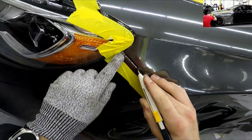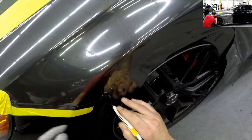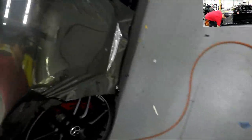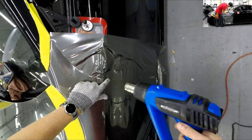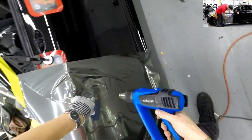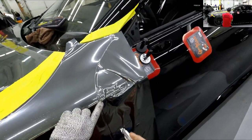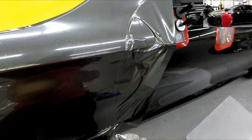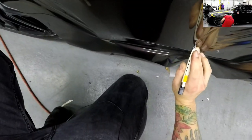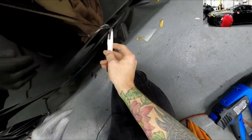I'm staying on the bottom edge for this cut. The vinyl can be polished — we tested it — so any swirl marks or scratches that won't heat out afterwards, we're going to polish. I'll go over this section with a bit of heat to make it smoother for cutting. It'll only get so smooth, and I'd rather not damage the vinyl. All the haziness you see right now from the shield guard is going to go away when I wipe it off. I haven't stretched the vinyl, so there's no reason to have haziness.